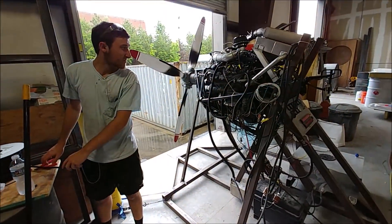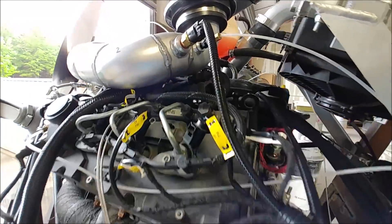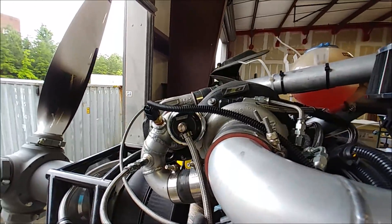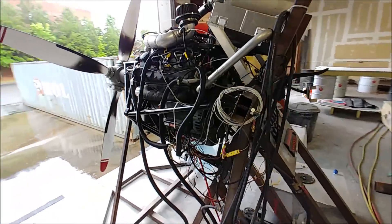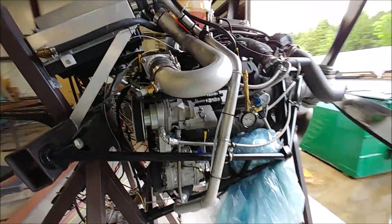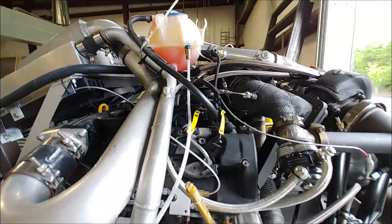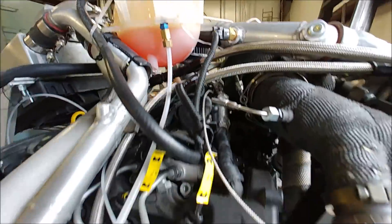The quarter-inch plastic wire conduit that I ordered arrived, so I had Jeremy quickly put some pieces of that on the other thin wires just to protect them. That stuff is good for protecting up to 400 degrees Fahrenheit, which is great for engine wiring. It's looking much nicer than it ever did — he's got all the single runs wrapped nicely. That job is pretty much done with respect to the wiring; I just have to add a couple of wiring runs still for things on the ECU.